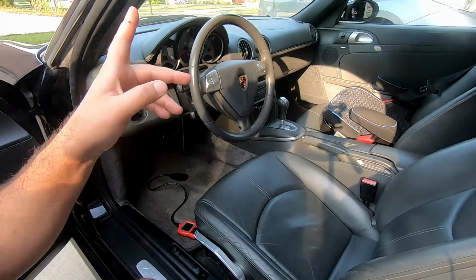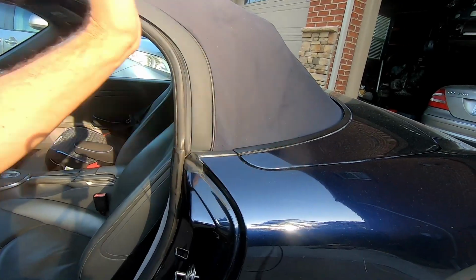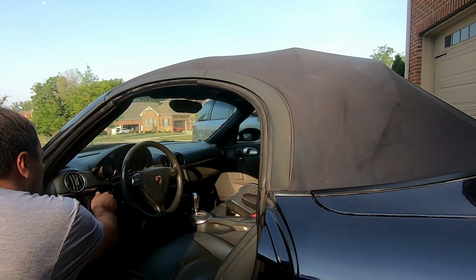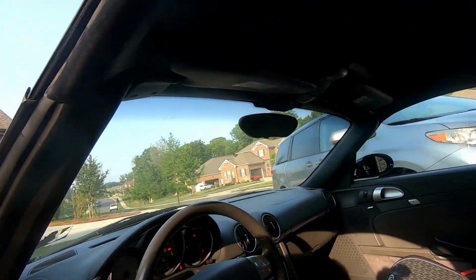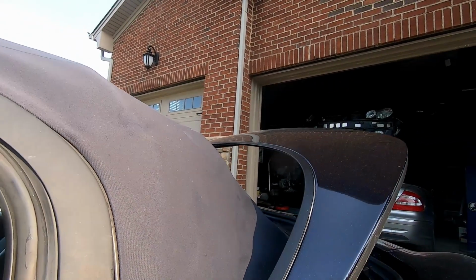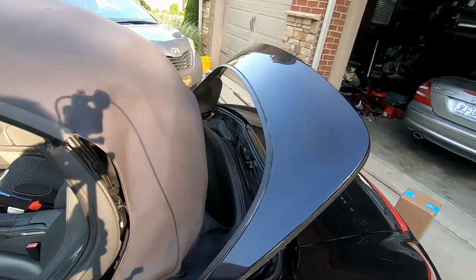Before we disconnect the battery, I'm going to need to put the roof into the service position, so the clamshell is up and the top is up as well, giving me some access to the engine bay. So let's do that. Here's the key. Release the lock. The windows go down into the opening position. And let's check, maybe it's going to be enough for us to put the roof into the service mode.